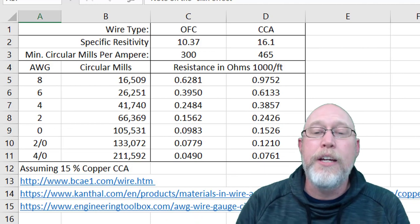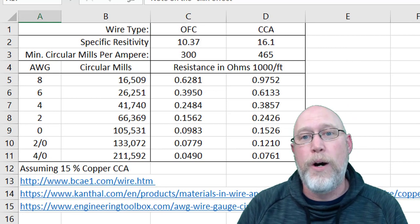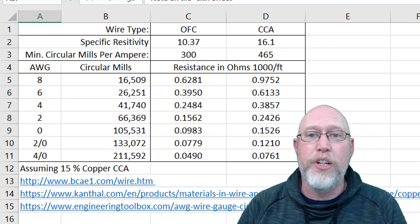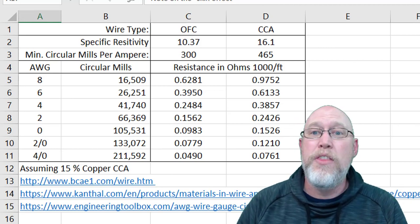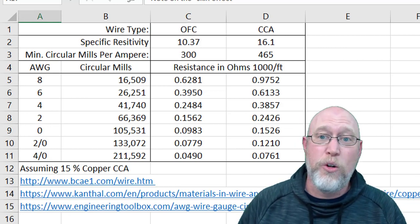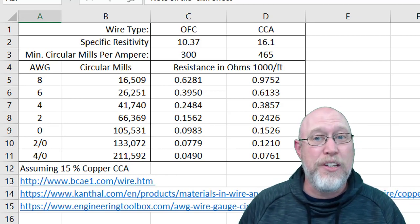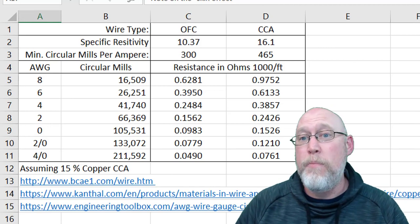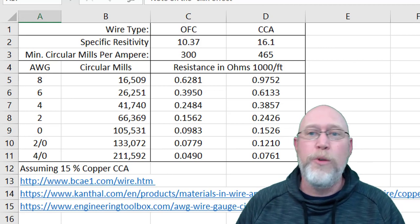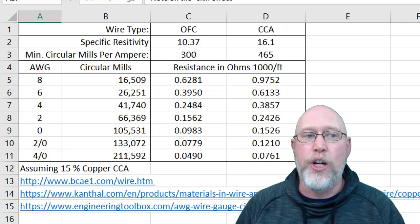Here's the first thing that you need to see. This right here is the foundation for all of our calculations. What you have to remember is that PowerWire has an internal resistance, and that internal resistance is a function of how long the PowerWire is and the cross-sectional area of the PowerWire. Longer wire means more resistance. Thicker wire means less resistance. I've got here on the screen several different sizes of wire in two different types. This is one of the big changes to version 2.0 — version 1.0 only showed you 0 gauge, 4 gauge, and 8 gauge wire, and I've broken it down to show you more different sizes.